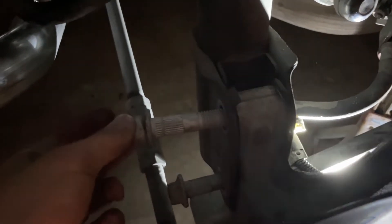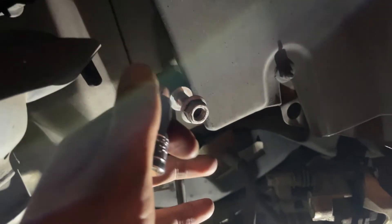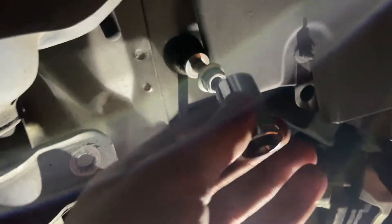We had to remove the brake caliper just so we can get enough leverage to pound these bolts out. Just like the front, it's a 21-millimeter and you don't even need a wrench — just undo the nuts. To undo the caliper, the two caliper bolts are a 13-millimeter socket. Then you just have to pop the sway bar end link out, which uses a 15-millimeter socket, and that just pops out straight. Now everything's pretty much out except we just need to pound these out a little bit more, then we need to come up in the trunk.